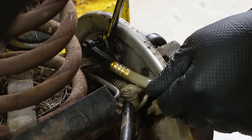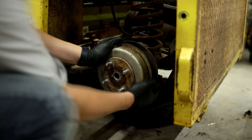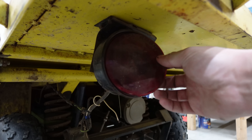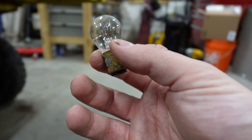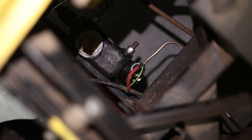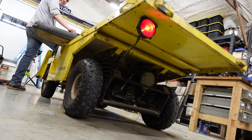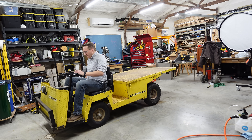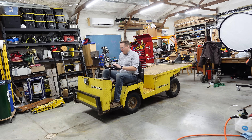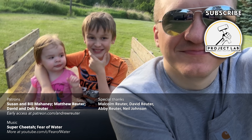I reinstalled it and tried bleeding the brakes again. And magic — fluid came out! Finally, I got both brake lines bled. I reinstalled the drums and the wheels. They didn't want to go on, so I had to adjust them into place. With the brakes fixed, I checked the brake light. It didn't seem to light up before. After sanding off the brake light bulb a bit and reinstalling it, it now lit up when the headlights were on, but the brake pedal did nothing. Good enough for this moment — I'll revisit that later. Finally, it was time to test it out again. The throttle worked, and so did the brakes. It was magical. And it only took me nine months — just like having a baby. There are still plenty of things left to do on the cart, but it's good enough for now. On to the next one. Thanks for watching.